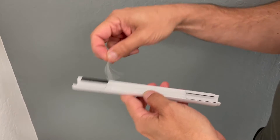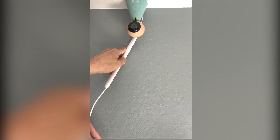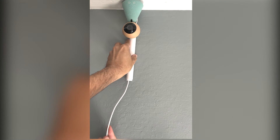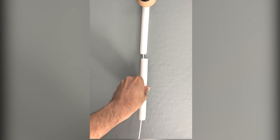To mount the cable covers, just peel and stick the covers over the cable. Make sure the indentation of the cover is facing down before installing. Install the first cover behind the sensor. The covers will then easily snap one onto the other.